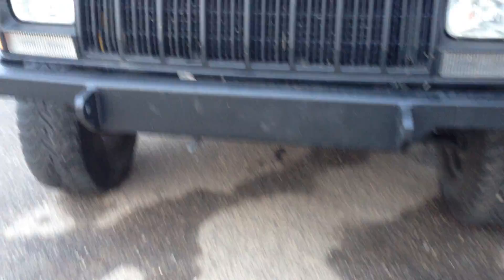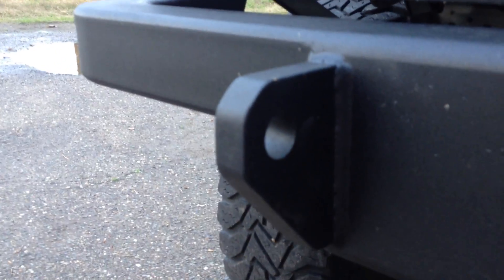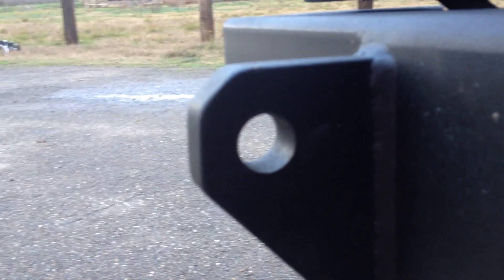So I wasn't going to make that mistake again. This bumper has fairly good ground clearance. I didn't make it able to support a winch, but I found some forum threads suggesting it's possible to tuck a winch in behind it, so when I get my 8,000 pound winch I'm going to give that a try. Off the center section here I cut out these lugs for extraction points - these are one inch plate. I drilled a one inch hole in them using a big drill press and a reamer, then welded those on with a heavy duty dual shield machine at 200 amps. They're solid as a rock.